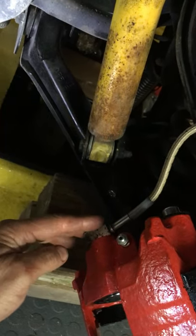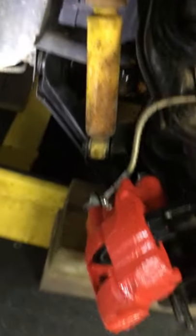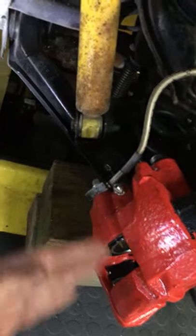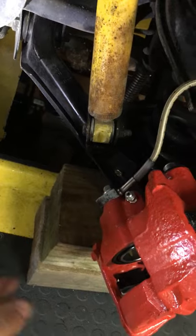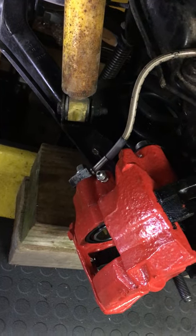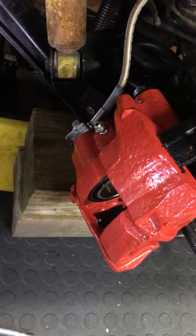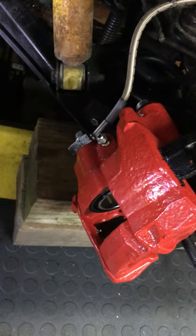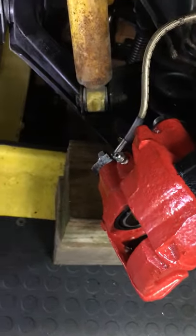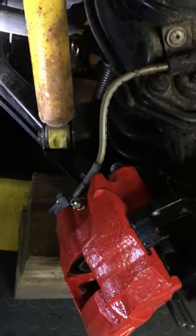The next significant issue was when I turned the wheels to full lock, the bolt that holds the brake line — which is in a different position than the original — would hit the shock absorber. That's dangerous because if the brake pads are worn, it pushes the piston in and creates a gap between the brake pad and disc. You'd have to pump the pedal a couple of times before having brakes back. Especially dangerous when parallel parking or in a tight area — you could hit a car or pedestrian.